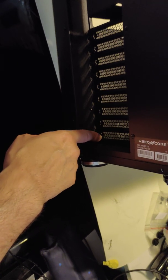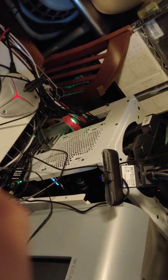9 expansion slots. So where I use an XL ATX motherboard, I require every single one of those slots. Currently, my case is a monstrosity, the NZXT H630, without a side panel, without a top panel, just because I can't fit the 420mm radiator that's on it inside because of the restriction of the two 5.25-inch drive bays at the front. So this still can't hold that, which I'm fine with.